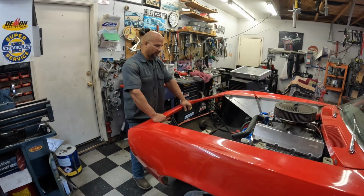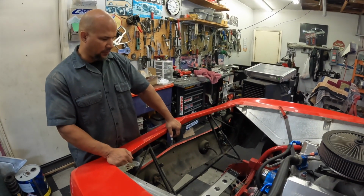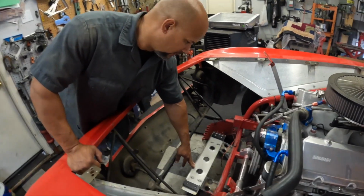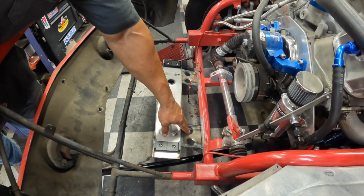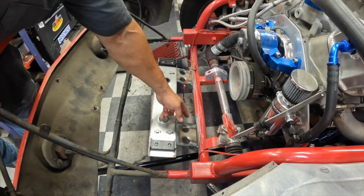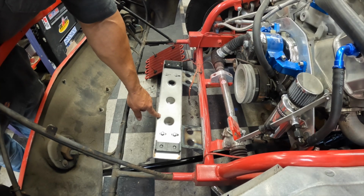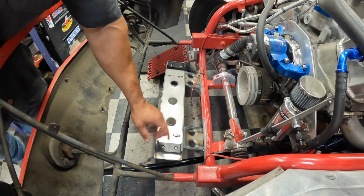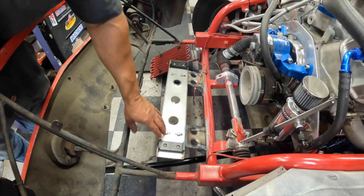Alright, so we're back on the Camaro today. We finished up with the lower mounting of the radiator. It consists of 2 plates that are 1/8 inch thick with some dimple dies and geometric strengthening features. Then we have a stainless plate that we machined, dimple died again, bent the corners up, and machined some Delrin, basically an interference fit for the radiator, so it holds it in place.